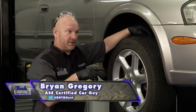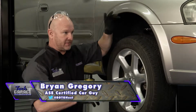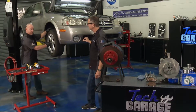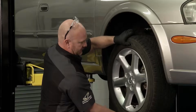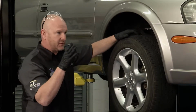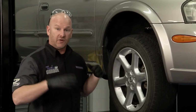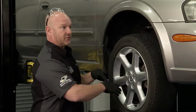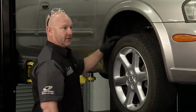And I'll tell you what, you talked about grinding. Let me tell you about grinding. Here's a classic 12 and 6 o'clock test. I got all the lug nuts off except for 2. They're torqued to spec. But look at this and listen. Holy cow, that's no wonder you were getting grinding. That wheel's doing this going down the road. So no further diagnostic is needed here. I'm gonna go ahead and get this disassembled so we can get en route to get a new wheel bearing hub assembly in here. Well, you get started, get those lug nuts off.